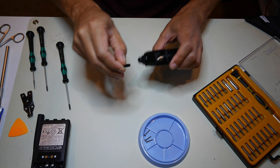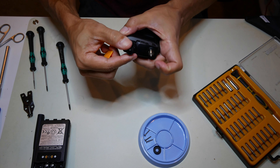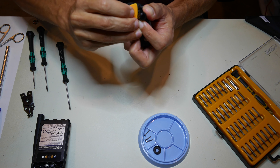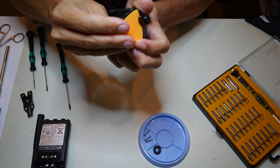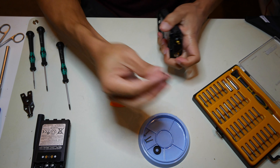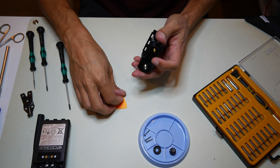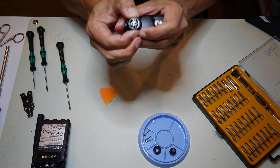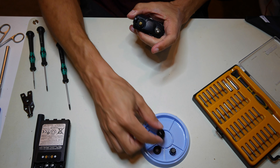On this one it's a little different. They actually have a couple of screws you have to take off, and the knobs aren't quite as easy to pull off. Using a spudger, you can go between the first and second knob and get it underneath, then press and pop the first one off. It's just a pressure fit, but on this radio it took a lot of pressure. The bottom one — if you squeeze it just right you can squeeze and pull it off. Notice the way the plastic is shaped: if you squeeze on one side it should release.